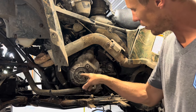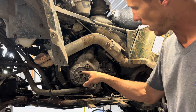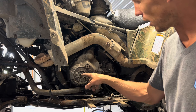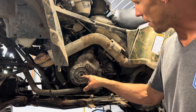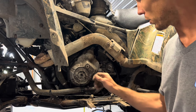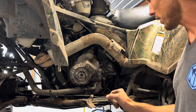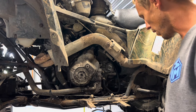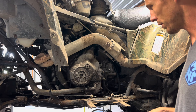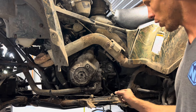We're going to pull the oil filter, which is directly in front of your magneto here. We've got an oil leak looking like it's underneath this inspection cap here. This is the inspection cap — this is where you turn your engine over to find top dead center and adjust the valves. So I'm thinking we've got a bad O-ring here, so we're going to replace that at the same time. We've got a gasket that we're going to replace here as well. I wanted to show you a brief overview of what we're working on today.